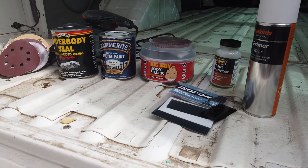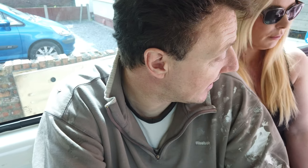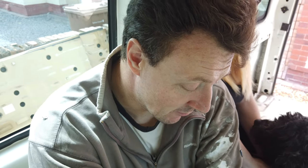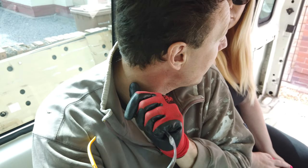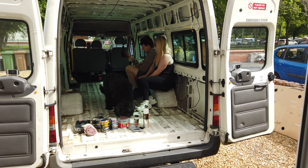But today then, we've got the supplies and we're going to carry on. I've just ground them bolts off. I tried to get it with the saber saw, but it just blunted the Bosch bit. So they are really hard steel. The grinder has got them down to a reasonable height, so just watch out because they'll be sharp and we'll have to put a little file over them later. My plan is to try and get this somewhat clean today.